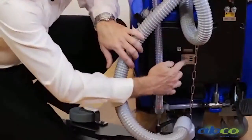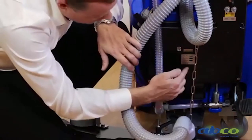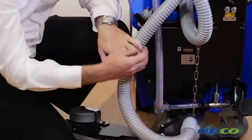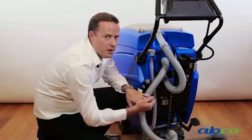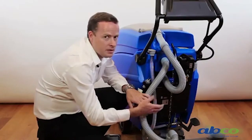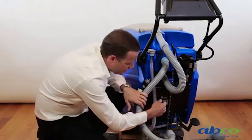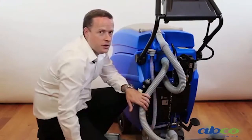We've got a series of lights here which will tell us how we're going with our charging. If you have a look at our far left light here — if it comes up red, that means there's a fault. You need to unplug it and re-plug it in to take away the fault. If it's still there, please contact AlphaClean. If not, your lights will go from orange through to a green light, which tells you it's fully charged.